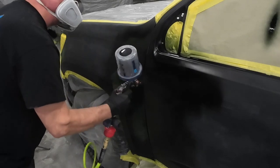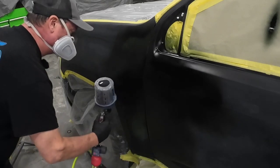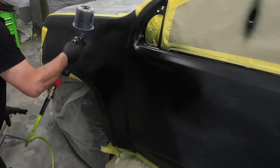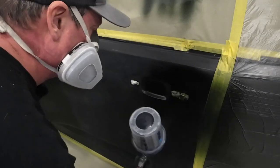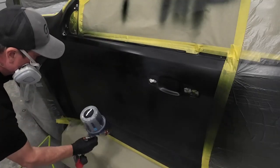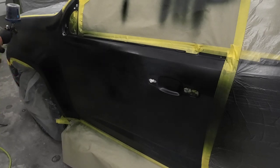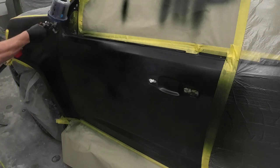When applying your base coat, it's important that you overlap your passes 75 to 80%. This gives you good uniform coverage and is very important if you're spraying a high metallic finish, because it helps eliminate mottling — which is an inconsistency in the appearance of those metallics. Here I'm blending out into this door and into the fender for a nice transition. It's not that critical on black, but on a high metallic like gold or silver there are additional techniques — I've got other videos on that topic on my YouTube channel.